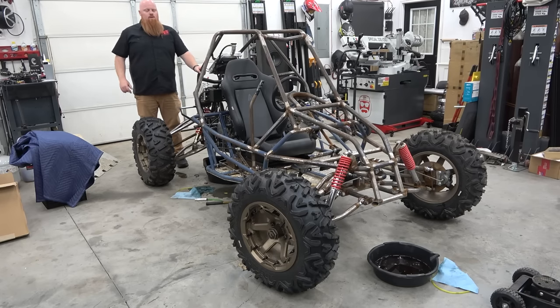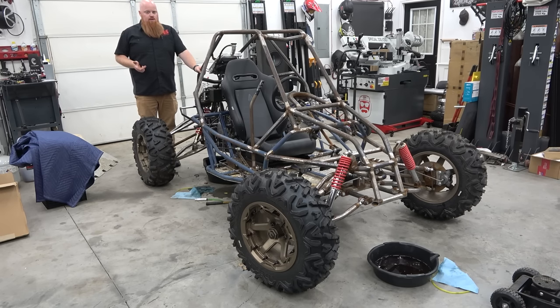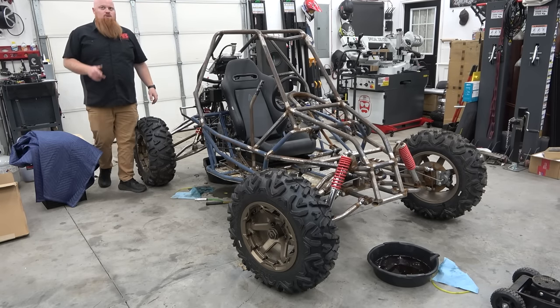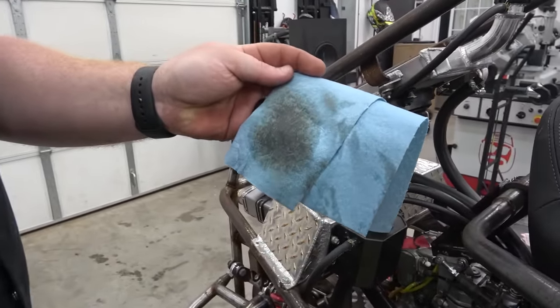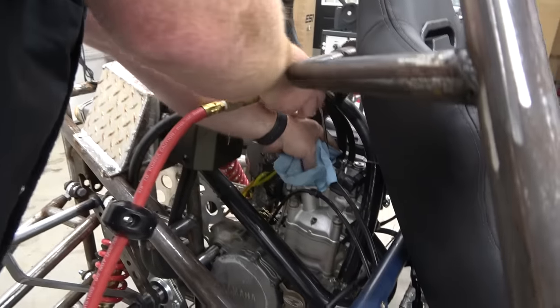Okay. It could be also where the cylinder's really wet with Blaster. Like I sucked all I could out and tried to do the best I could, but I bet that is the main thing. So I'm gonna pull the plug real quick. Okay, so that was pulling the plug and just kicking it. It definitely was old, like it's just wet with Blaster.